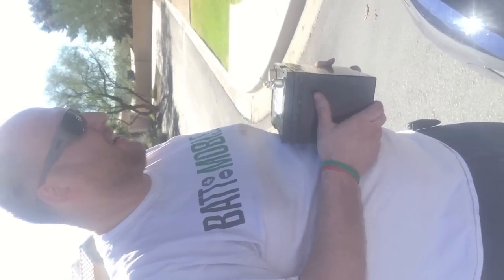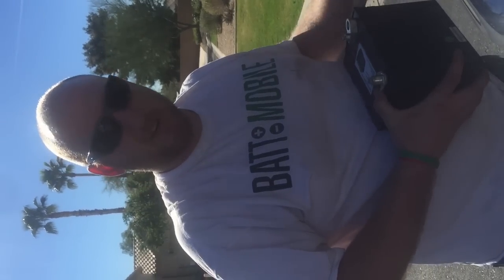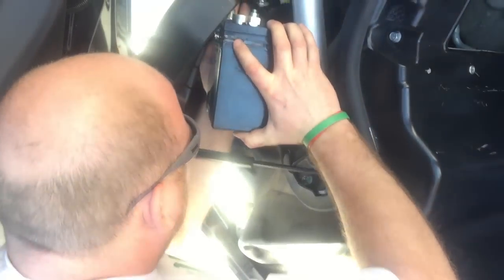When it comes to putting this battery back in, it'll be a little easier because it has less weight and we made it slightly smaller — not a lot smaller because we wanted more capacity than the original, but we kept it about the same size so it fits tightly and isn't too loose. Going in, same as with the old one: insert it sideways and then twist it into its spot, with the terminals facing the driver's side of the car to make it easier.